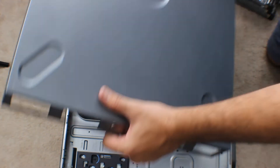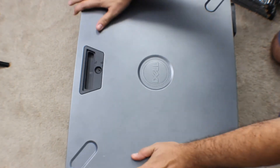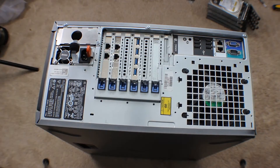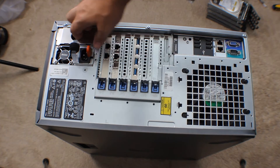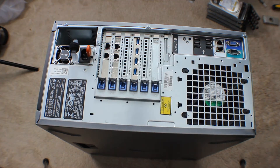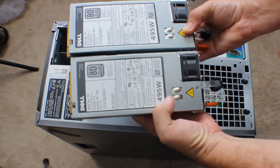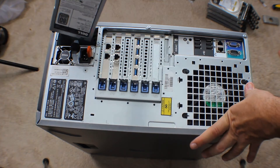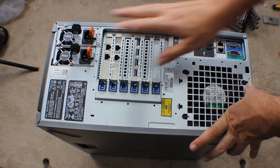As soon as we get that done, now we can go ahead and seal our case back on, and then we'll move on to the hard drives and the power supply. Alright, we have the server turned over. This is literally the easiest upgrade you can do — we're going from one power supply to two redundant power supplies. You can literally just pull this blank panel out. This is very important: you want to have the exact same watt power supply. This is the 495W — you want to add it with another 495W. If you upgrade to the 1000W or 980W power supply, you can really do some damage to your server. So you want to make sure you use the same watt power supply.